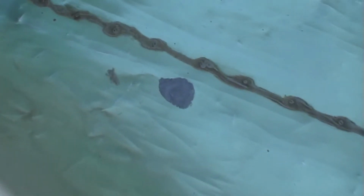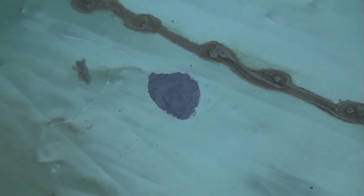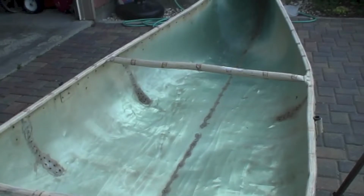Okay, well, as you can see, the leak that was there has been epoxied nicely. We did that to the top side, and if I go around to the underside, you'll see that a similar coating has been made. Now, the nice thing about this stuff is it's super, super strong. It creates a really solid bond on the metal, and once it dries in about an hour, you're able to sand it and make it nice and smooth and get it to fit the body as close as possible. That was the only major leak. Now everything else will be sealed up with a different product that I'll show in a sec.